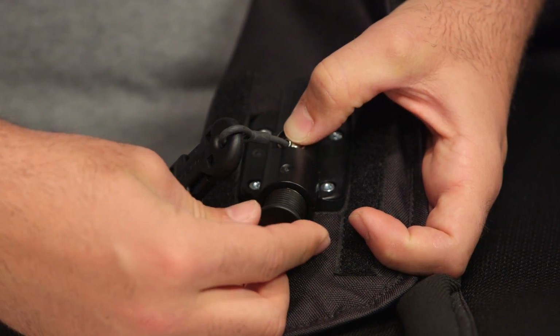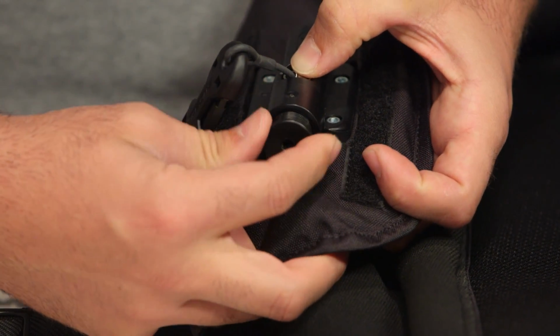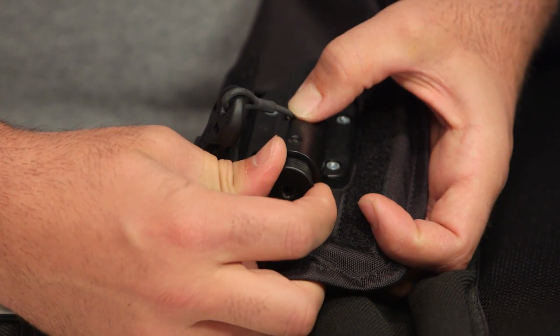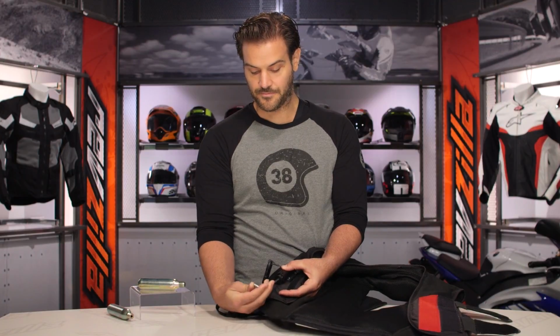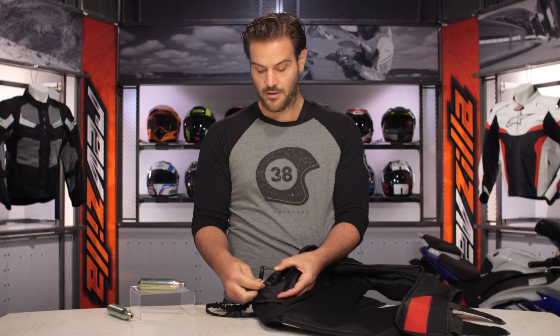And like I said, as long as you hold that little tether into place, this you can use to just screw in by hand, and you'll feel it get tight on the ball. And once that starts to get a little bit snug there, that spring is pressing against it, and you'll notice that's not going to just pull right out on you. And then you can switch back over to your Allen wrench, and you can just start to tighten that back up.